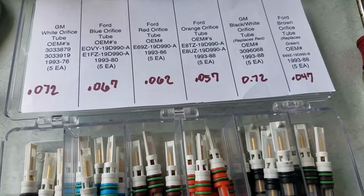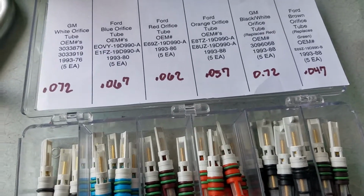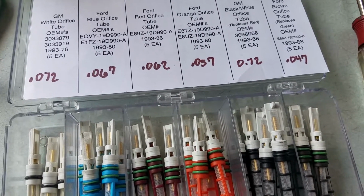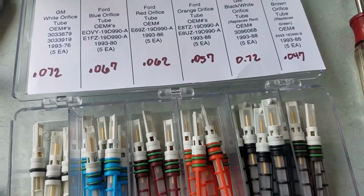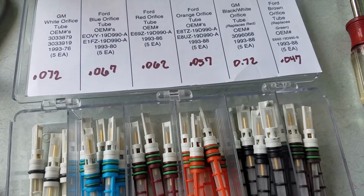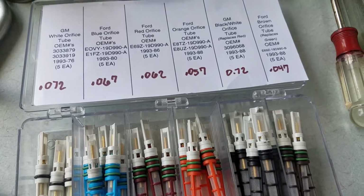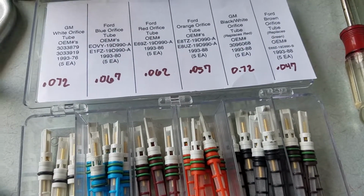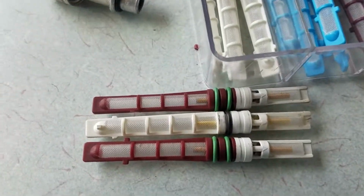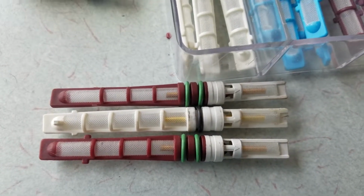But as you all know, any gas that when compressed turns into a liquid is a refrigerant. So having a little butane or propane in the front of the car, in my opinion, is not dangerous. It's no more dangerous than the 30 or 40 gallons of gasoline you're sitting on. If you treat it with respect, handle it properly, it's very safe. Clearly, if you got into a crash and something was to damage the AC line, that would be venting out, and again, it is flammable, so something to watch out for. So that's how you can use a different style orifice tube in your Chevrolet.